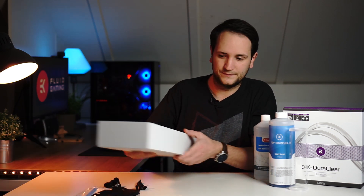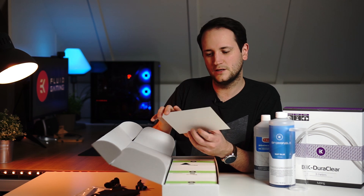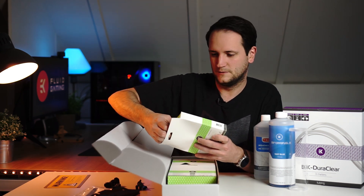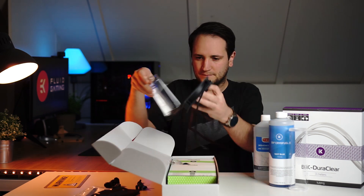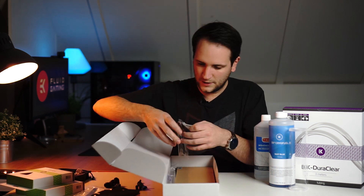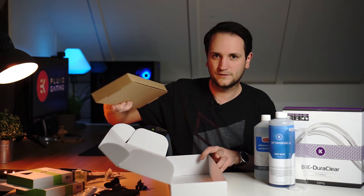Next, let's open the radiator. It's a bigger box, and it's not just a radiator — you also get three fans included. With every packaging there's a label warning you never to mix anything with the aluminum set, because mixing copper and other metals causes galvanic corrosion, which you really don't want in the system. The three fans look good and come with screws. There's also a fan splitter for the three included fans, plus fittings.